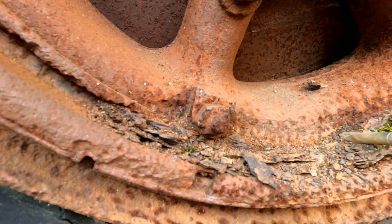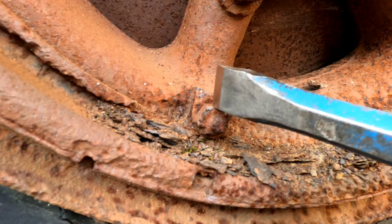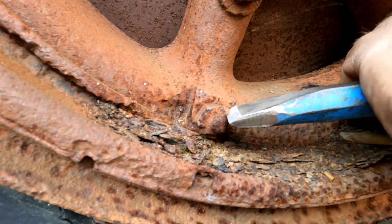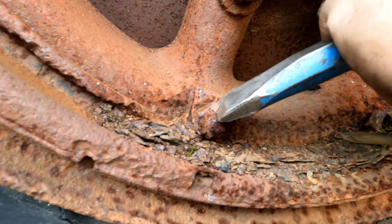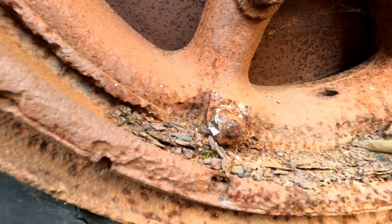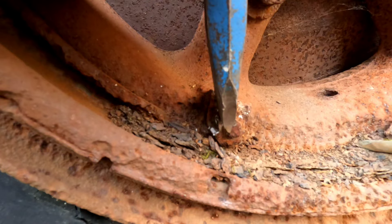Metal back in the 20s wasn't that hard - it was pretty soft nuts and bolts, probably grade two back in the day. So before I go and get the torch and cut it off or take the grinder and buzz it off, I'm just curious how stuck it actually is. You can see that's turning - my attempt is to try to get this wadded-up part broken free so it can come apart in one piece, without having to spin it all the way out.